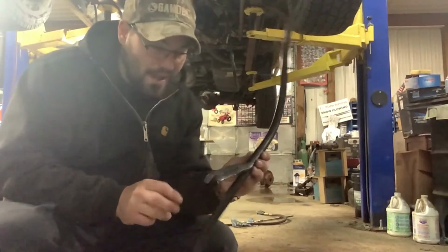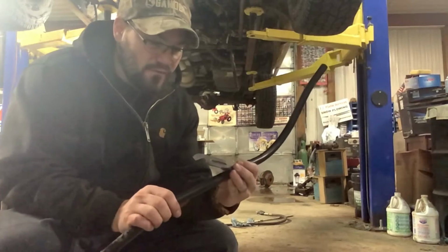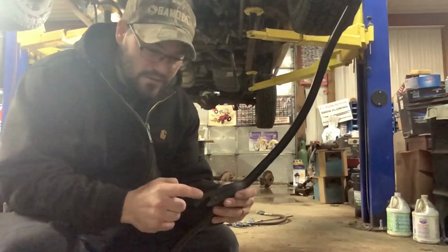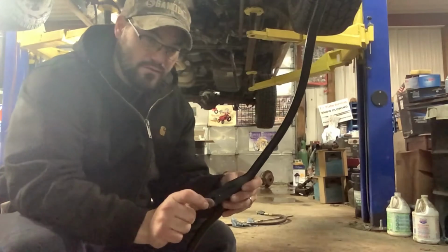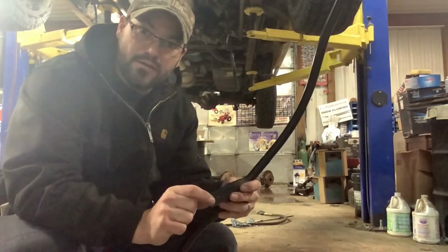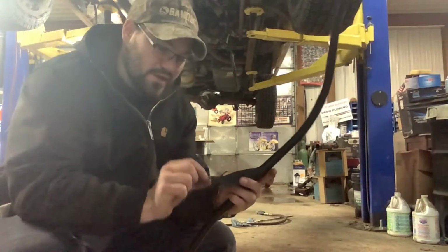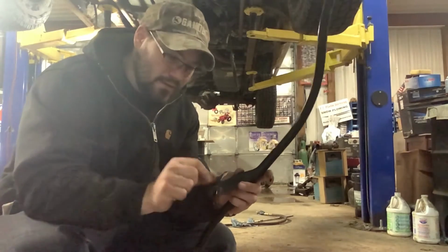Hello, we are back and I have this dipstick tube, and I thought of a possible issue with just using the bolts instead of the bolts with studs like they're designed. This little bracket here typically goes onto the stud that's behind the special stud bolt. A 10mm thread goes into the block, and this is an 8mm, so it's a smaller nut. My issue is I wonder if that little 3/8 of an inch or so, the thickness of the bolt head, will matter.